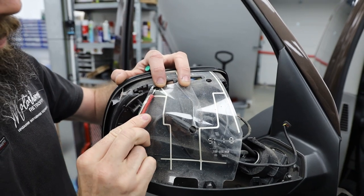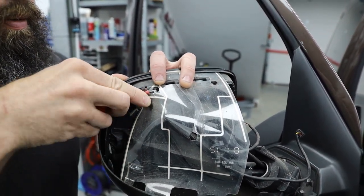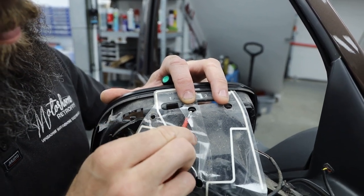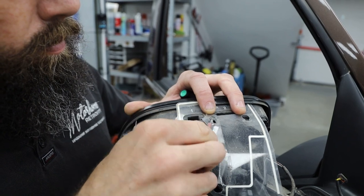You're getting a little thin screwdriver in to release the little tabs on the circuit board. You can see they just fit over — it's quite a rigid bit of plastic, so don't be afraid to get your screwdriver in and release those three clips along the top section.